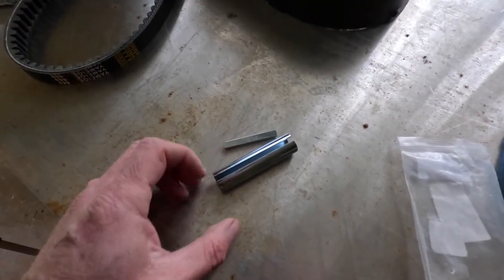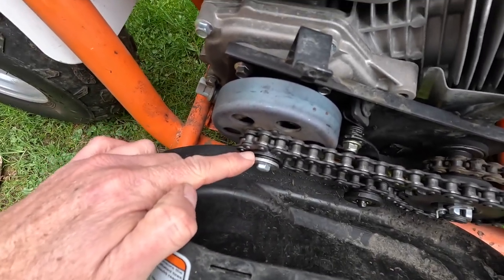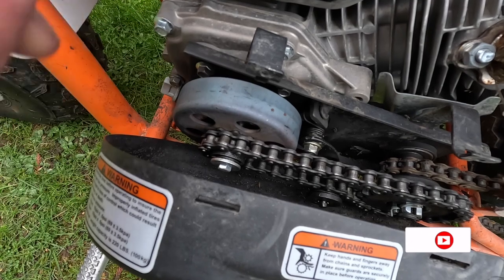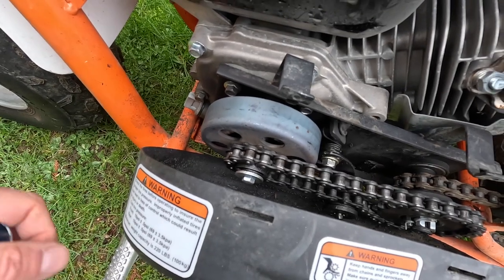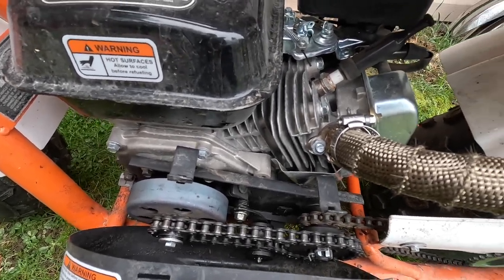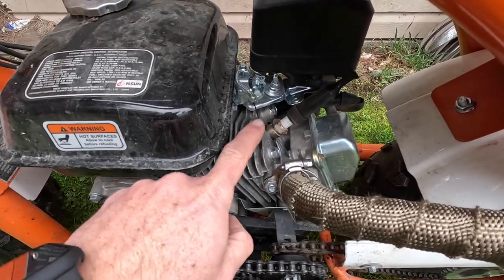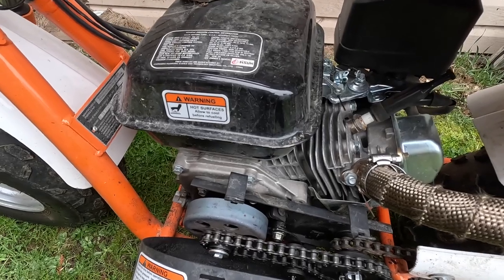This is the secret sauce to making it work. For some weird reason the output shaft on these engines is 16 millimeter — not three-quarter inch like pretty much every other engine you can get. So this is an adapter that will increase the diameter of the shaft to three-quarter inch using the key that comes with it. This is only one stage in the evolution of things I'm going to do to this minibike. I will be replacing this engine with a slightly larger 212cc one — it's bone stock except for the exhaust, and I haven't even removed the governor yet.